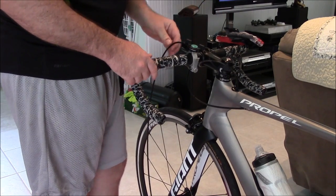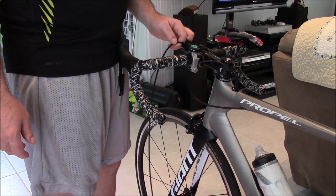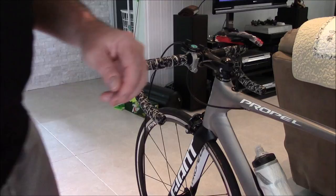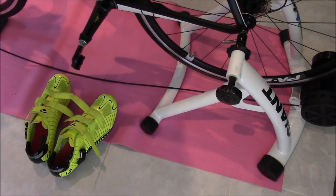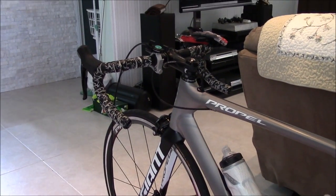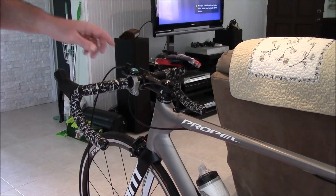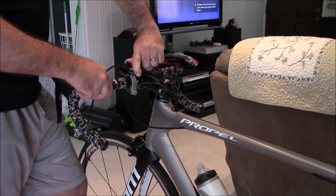All the way down here, the lower the less resistance you want: the more it's pulling on the cable here — it pulls on a cable similar to your gear adjustment. That cable comes all the way into the back part of the magnet assembly, and the point of the cable adjusts and releases tension from the actual magnet assembly itself.